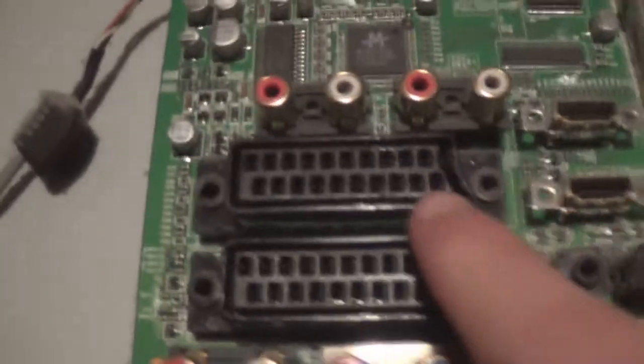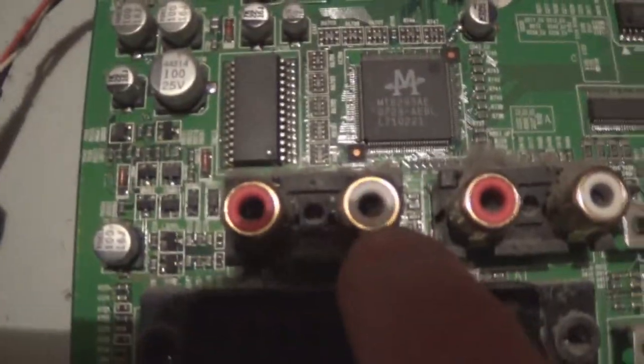This is definitely dusty. I'm going to do a shot of the main board first. These are clogged up with dust - the ports, the dust build up there. There's vent holes almost clogged. Power supply... like a blanket underneath it. One, two, three, four, five - there's six bad capacitors on the power supply.